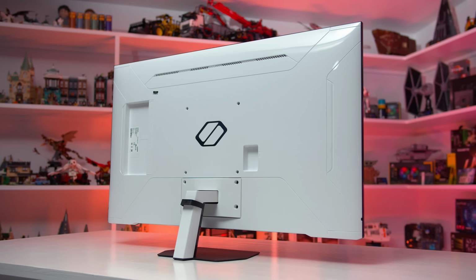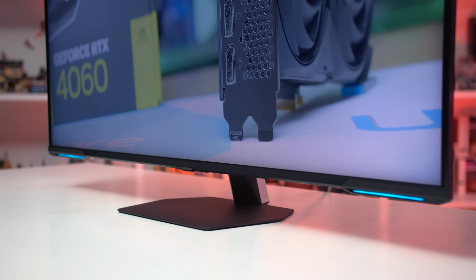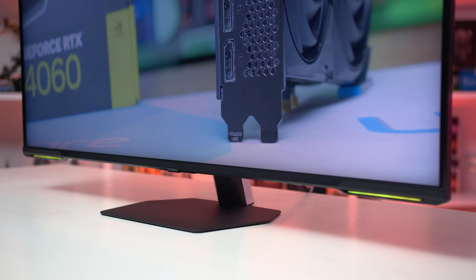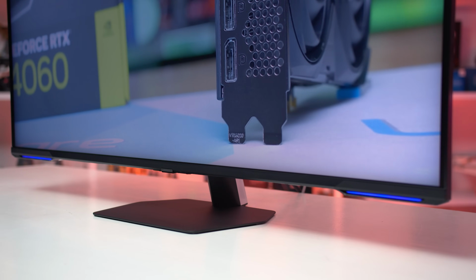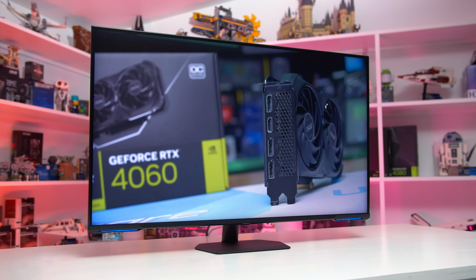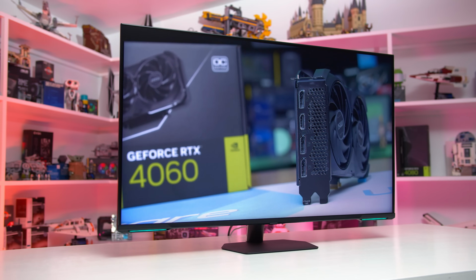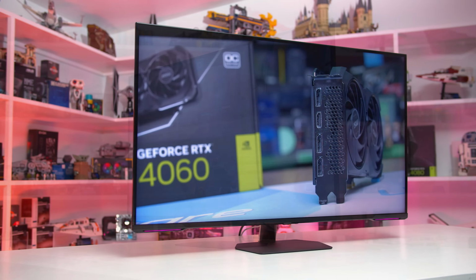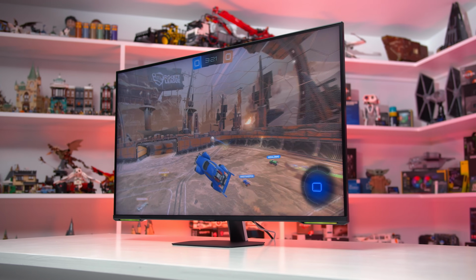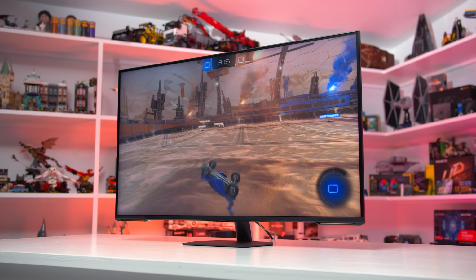It also has some clear advantages over an OLED of a similar size in some circumstances. Again, this is mostly for productivity, where OLEDs are at risk of permanent burn-in, have low SDR brightness, and use a subpixel structure that isn't great for text rendering. The LS43 uses BGR, which isn't amazing either, but it's better than anything OLED uses, and opens up the possibility of a generally good experience at 100% render scaling, which gives this monitor heaps of screen real estate. So I can see a specific subset of buyers choosing something like this over an OLED, those who are primarily using their display for work and want something big with nice text clarity.